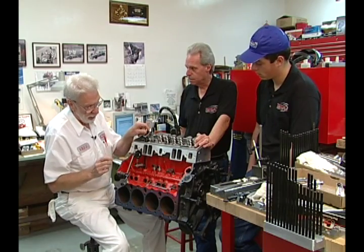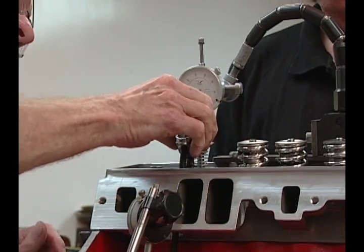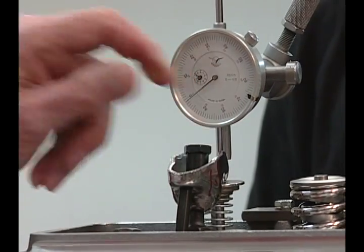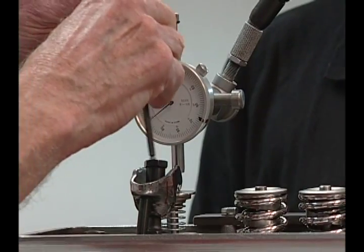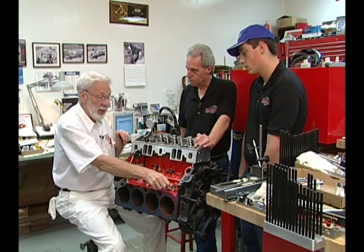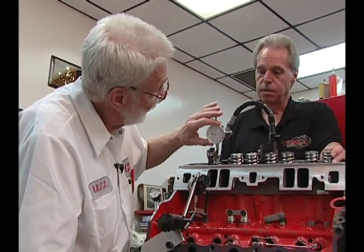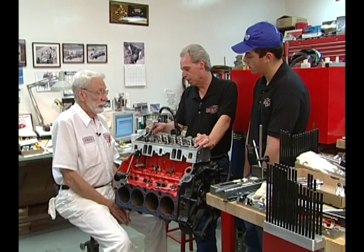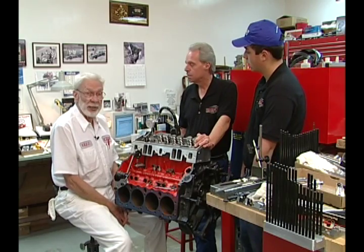This is just the attack angle and the swipe across the valve. We have plenty of room over the valve to run this arc, so we won't have any problems in that area. If you would carry this to a far enough extreme with the length of the push rod change, you would have to stop just short of coming near the edge of the valve — unless that was a desirable place to be, then you could run with a lash cap, which gives you a much broader area to run against. The lash cap gives you a little retainer clearance and more diameter to run. Absolutely, it helps one hundred percent all the way around.